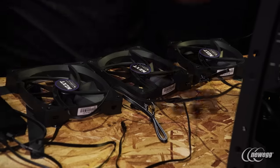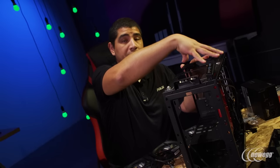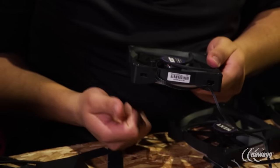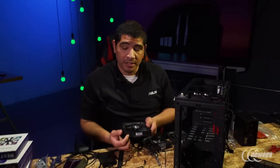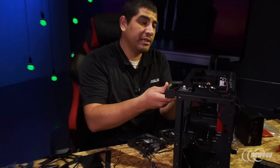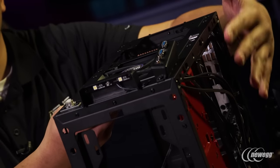Moving over to the top of the chassis, we'll have a 140mm here, another 140mm here, and then a 120mm in the back. One important note: you want to make sure the orientation is set correctly. Do the cable connections before you physically install the fan so you don't run into cramped issues trying to plug in very small headers. Make sure to have the orientation for the cables facing toward the back of the chassis to maximize cable routing opportunity.